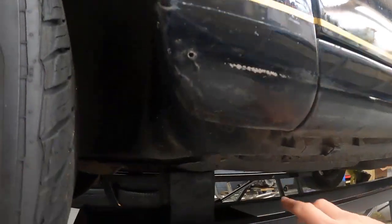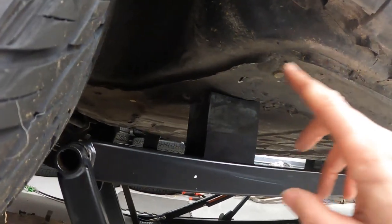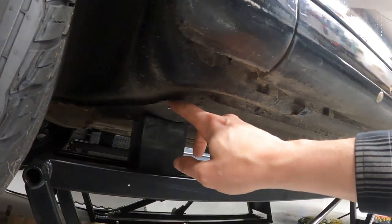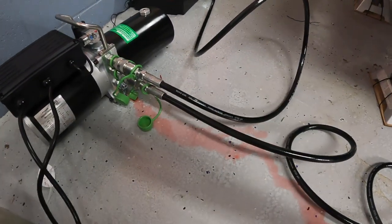The other place I'm using in front is this pivot, which is going to be really close to the front wheel. The block is just on the corner of the pan here, just behind the pinch weld. Seems like this is a pretty strong place — maybe people will argue with me about this, I have no idea, but it's been working for me.